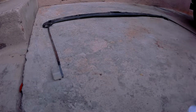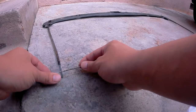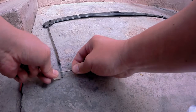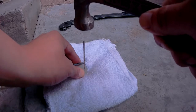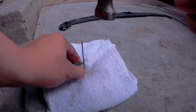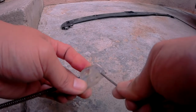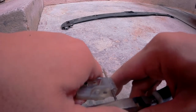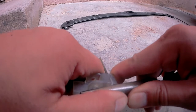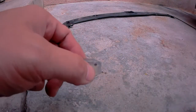Hopefully you've given your glue enough time to dry before you start working on these pieces. Once the glue is dried, it's time to insert this pin. If you take a close look at this pin, this side has splines. You might have an idea to insert it like this, but inserting it this way makes it more difficult to install. You might get the idea to use a hammer to hit it right in — but don't do this, you're going to break your part. Watch as the piece begins to shatter — this is completely wrong. What you should do instead is insert the smooth side in first. Then using some pliers, you can press it right in and it'll just slide right in. Once it has been pressed all the way, the splines will be in the correct location. And since this is the driver's side, the pin should be pointing inside the cabin.